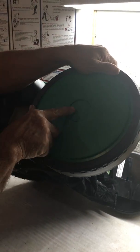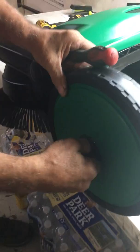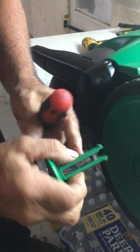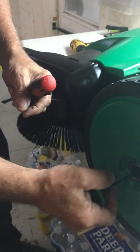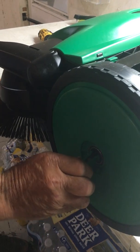To remove the rear wheel, on the hubcap you've got two notches — one at the bottom and one at the top. Take a straight screwdriver, get behind the wheel clamp and gently pry it out. Once you've got it out so far, slide it out. You've got two sides of your wheel clamp. Make sure when you put this clamp back in that you have one on the top, one on the bottom — not side to side. That's wrong.